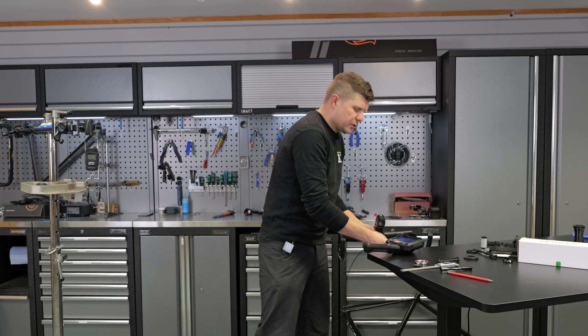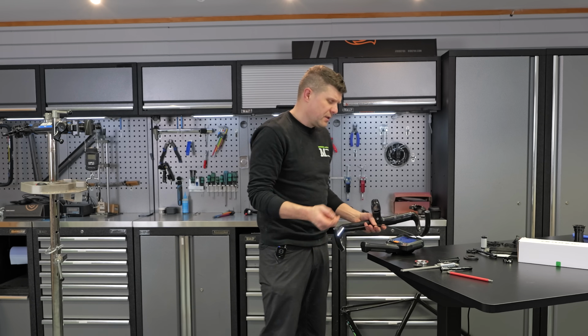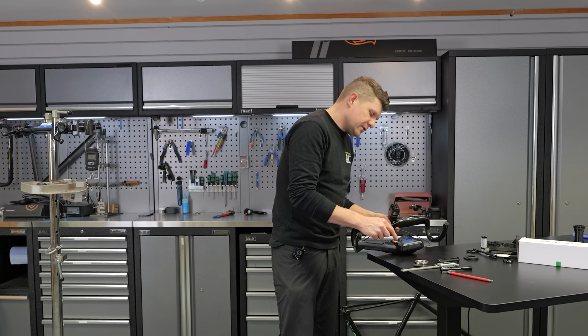And again, I want to show you the inside of this because there are some really quite stunning features. It looks really, really messy, but these are the rivnuts used to hold it in this little plate here. Now, handlebars get very sweaty and they're normally the first bit that gets covered in muck as well. So if you've ever had a Pinarello Most handlebar, you've probably experienced these rivnuts just disintegrating. What you're looking at is actually a surface preparation to stop them rusting.